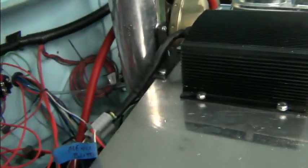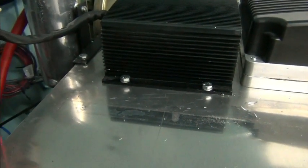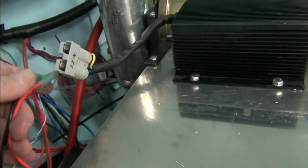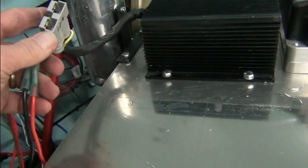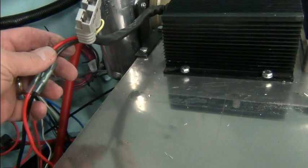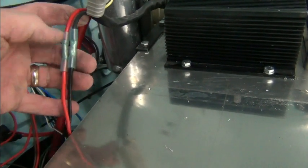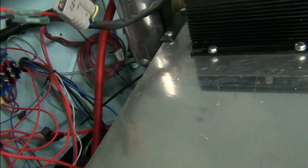Not your friend. I'm preparing the upper board here for removal, and so I'm going to leave the DC to DC converter connected, but I was checking wiring here. Well, this is the Anderson plug, your 12 volts out, and this wiring here, number 12 gauge wire here, is your high voltage in. Well, just looking to see where it connects to, and I noticed the black wire here. I'll pull on it and you can take a look.